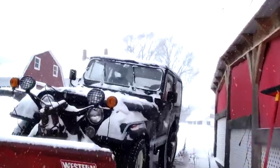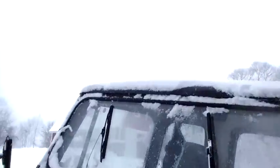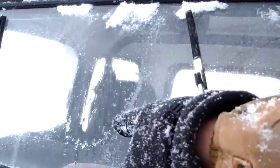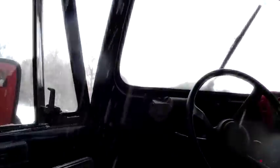Somebody asked me about this little plastic $35 defroster thing that I put in this Jeep, and it works. You can see it's defrosted the windshield right here in the center. If you listen, you can hear the alternator squealing. That's because the little thing pours so much energy that it just about overstrains the electrical system. I literally had to wire this directly to the battery because it kept blowing the fuses.